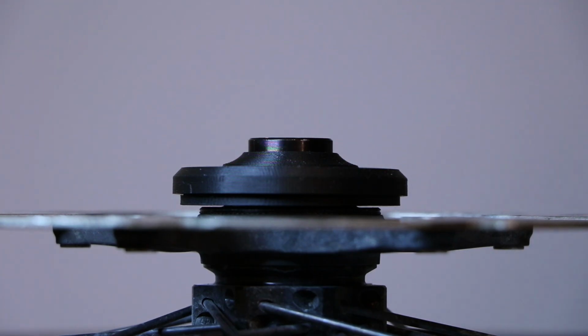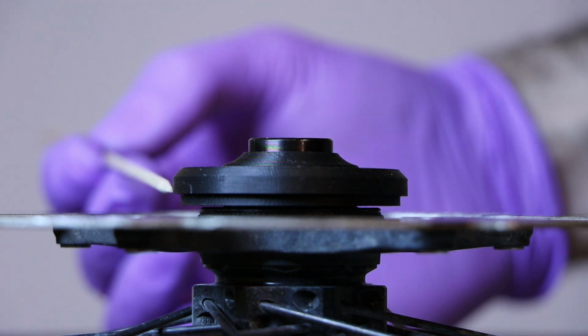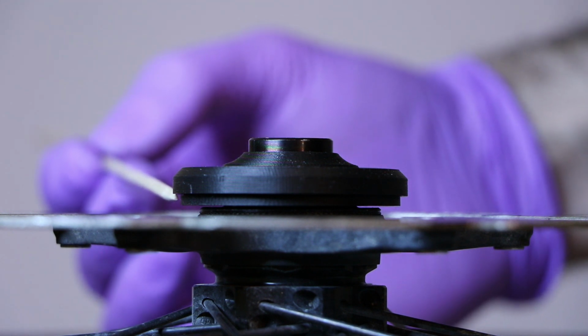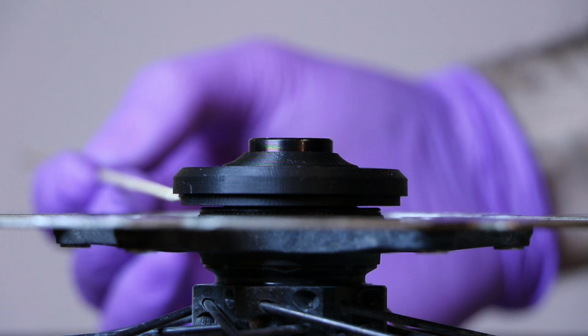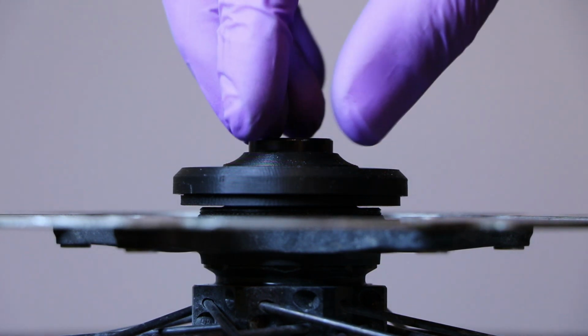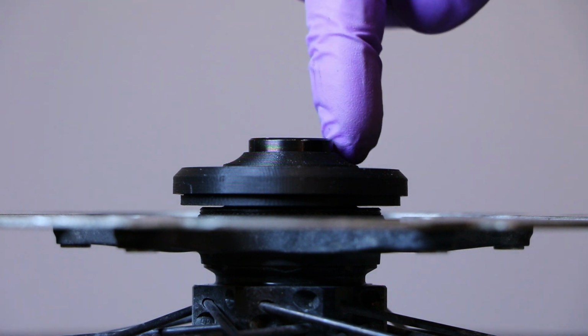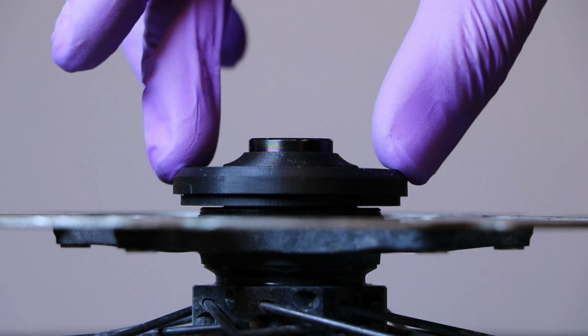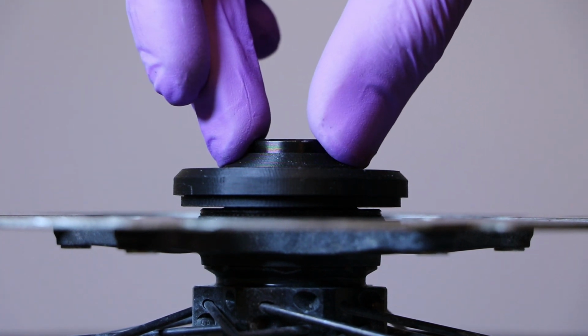And we're back. What's the idea here? The proper installation depth of the Planet 3 ring gear for the center lock version is the same as for the 6-bolt. We have to align this edge of the ring gear, the visible one, this one right here, with the lower visible edge of the Sun Gear. The pushing needs to happen on this raised bevel edge that's right around the end cap. You do not push the device on the sides, okay? You push in the middle, right here.